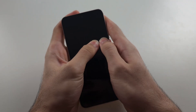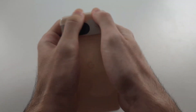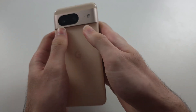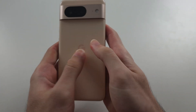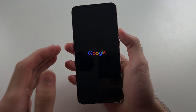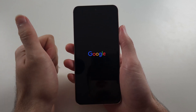Repeat this for the entire screen. Then do the back — push really hard down all across the phone. And if you hear a click, that means the camera is now being reinserted into the phone. Long press the power button, turn back on your Pixel, and then check the back camera — it should be fixed.